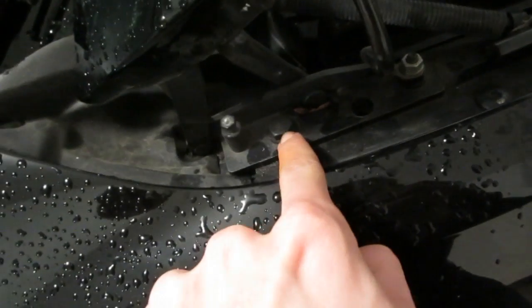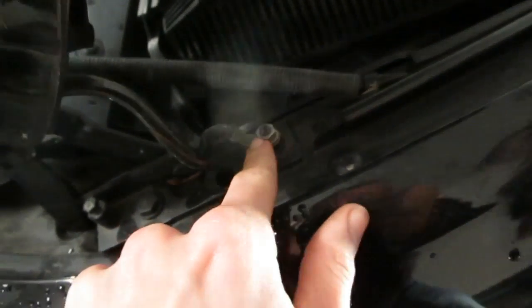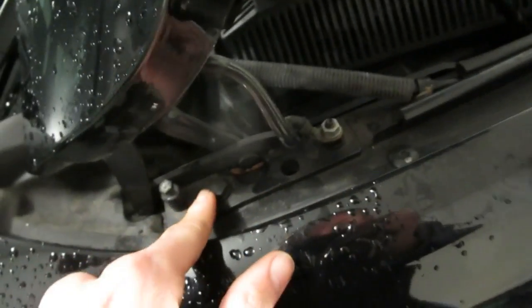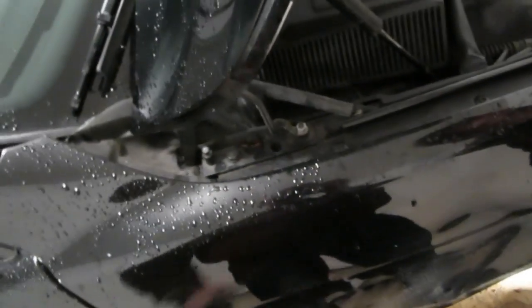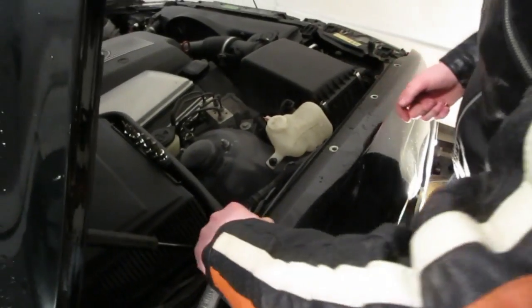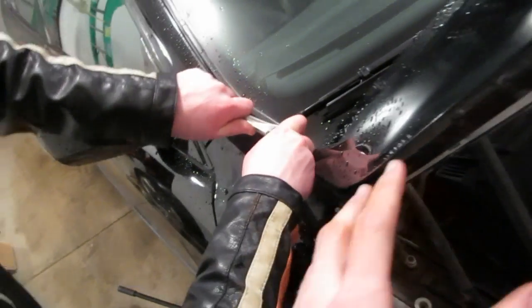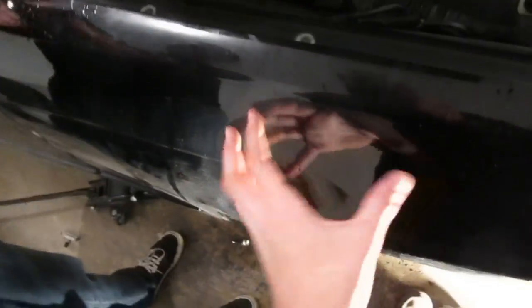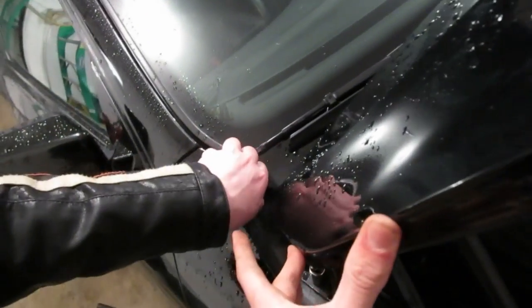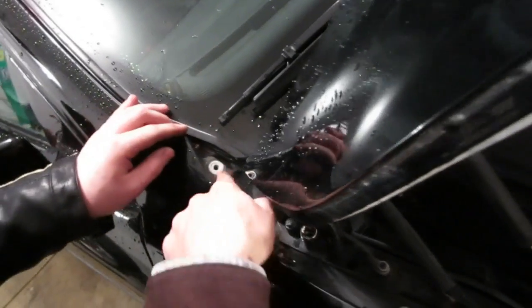The hood latch looks like there are two primary bolts that hold this on — both 13-millimeters. And then there's a grounding cable on top with what looks to be about a 10-millimeter bolt. So we should be able to take the ground off, remove the 10-millimeter bolt, put it in a dry safe location. Then we're going to loosen our 13s and hopefully just be able to slide the fender up a little bit and then out away from the car. There's a piece of rubber trim that comes on the end of the fender here — you don't have to remove it now, but you are going to want to switch it over to your new fender if it didn't come with one. One more bolt right here behind — and be very careful, you're next to a lot of painted surfaces. You're replacing the fender so you probably don't care about that, but your hood you probably don't want to mess up. Please be careful with your ratchets around the good panels. This piece of weatherstripping lifts right out to reveal one more 10-millimeter bolt.